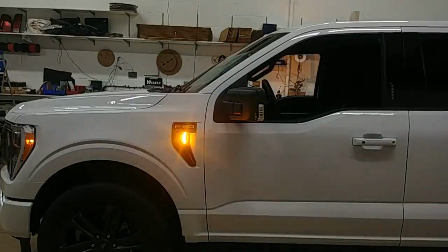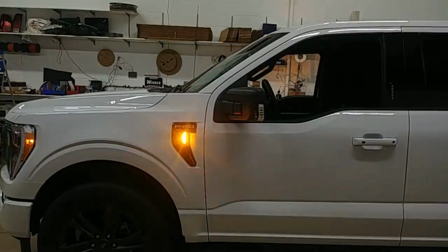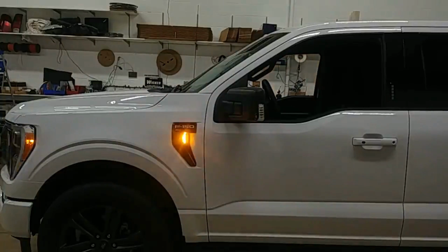We did supplement the front mount in the grill and the badge mount with a little extra RTV silicone just to help it stick a little bit more. But duly noted, the front grill and the side badge has no holes drilled in it whatsoever for these installs as well. The 4-inch mpower in the front grill, stick mount. We use the adhesion promoter and a little bit of extra RTV from the backside. Same deal on the side badges. Side badges pop off nice and easy.